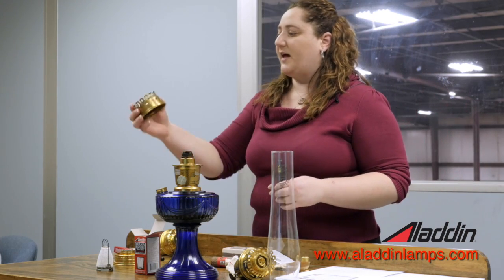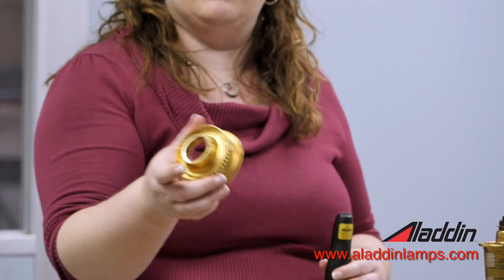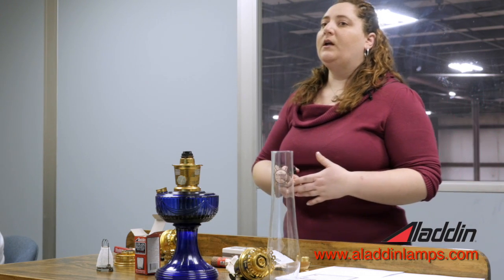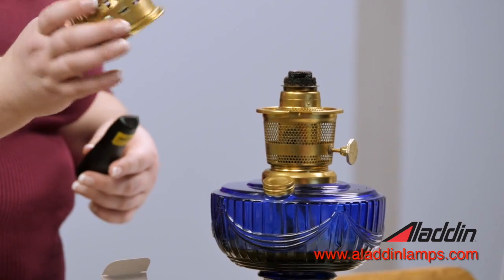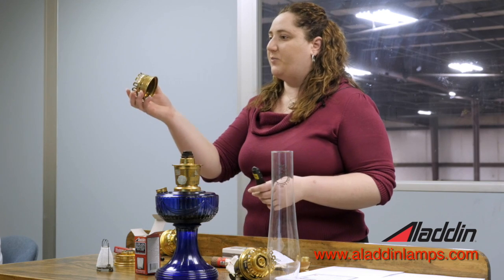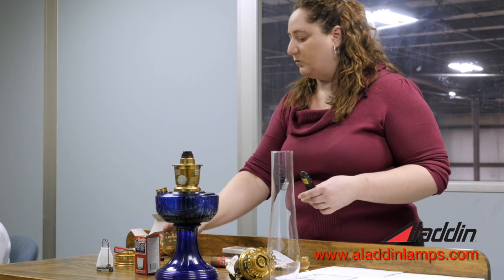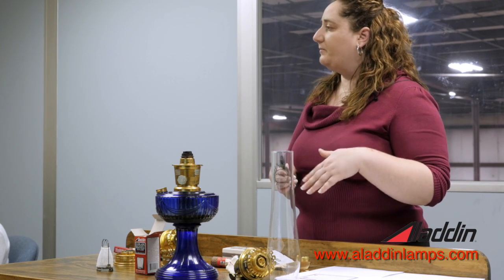Everything comes Heelless now, which means the gallery looks like a crown with tabs on it. The Loxon version is no longer being made, so everything is moving to Heelless for both kerosene and electric. The gallery is the upper detachable part of the burner, and every time you're going to light or clean your wick, the gallery comes off. If you want to convert your old Loxon gallery to the Heelless variety, you just buy a separate gallery — it fits right on the burner basket. Loxon chimneys have a tendency to crack more often than Heelless ones, so switching over is a good suggestion.